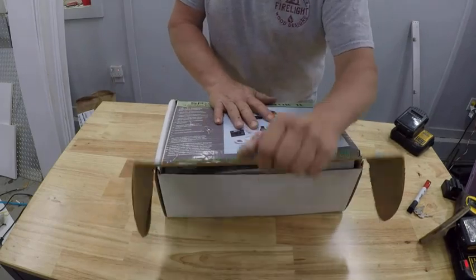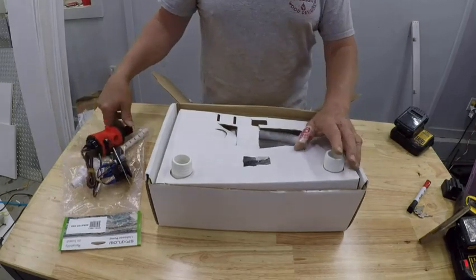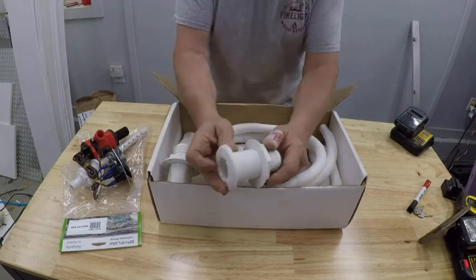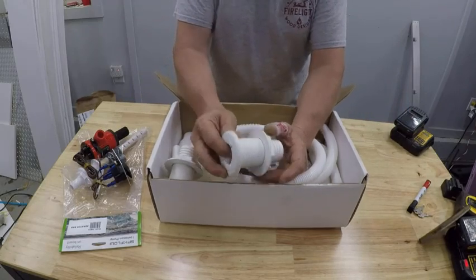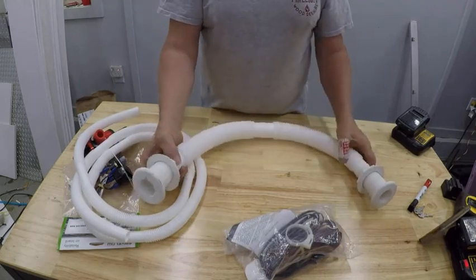My boat — I don't know if you've seen my Starcraft catfish boat build — you'll see plenty of videos on my page that show that, and I'll put a link up here. On that boat, the live well is only about 75 gallons. I don't need that much, but I had room so I built it. That live well is a constant-flow live well. Once I put the fish in it, I turn the pump on and it starts filling with water. I never cut that pump off. The pump has an overflow on both sides up in the front, letting water dump out as quick as it's coming in, so the water's always being turned over.